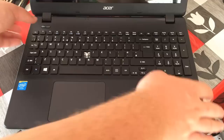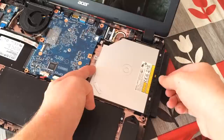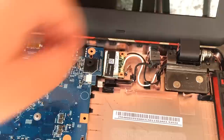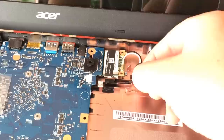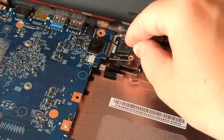To install, you'll need to access your laptop's motherboard and locate the PCI Express mini port, removing the wireless card. I also removed my DVD drive because I only had access to the motherboard from under the keyboard, so when I refit the keyboard the cable can run through the hole where the DVD drive usually sits. Usually you'd only need to take the back casing off to access the wireless card, so I have no idea what Acer were thinking. Once that's done, connect this cable to it and screw it into place — though with slightly different layouts, screws may not be required or may not fit.